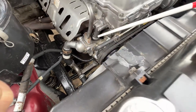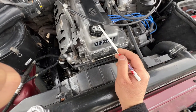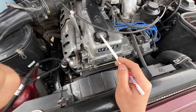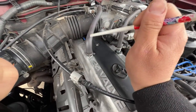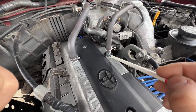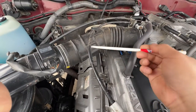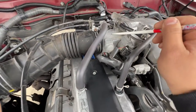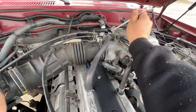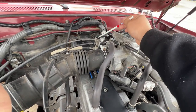Moving into the middle — this is where you fill your oil. Typical oil is 5W-30; you can run 10W-30 if you're in hotter climates. This is one of your valve ventilation, this is the PCV — it's always good to replace this; the grommet and rubber hoses always get hardened. This is the intake tube; you can take this off and then this piece can come off — you just have to remove the throttle cable. Right here is the throttle body. These hoses here have been capped off but they need to go to the EGR. This is where the EGR would go in. So if you were to delete the EGR, you have to block the intake manifold up here, and then on the cylinder head on the bottom far back there's another block-off. Make sure you guys watch my other video — I did a video about the 1FZFE EGR delete.